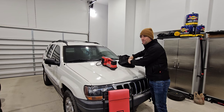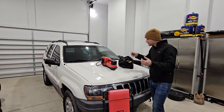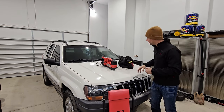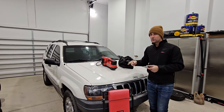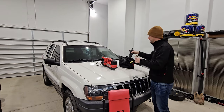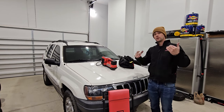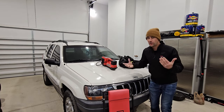What else do I bring? I really don't bring too much. Some rubber gloves so I can check oil. In our 3.7 and 4.7 Chrysler engines, they're known to burn oil, so I like to check before I drive the thing home and bring a quart or two of oil with me. This vehicle had been sitting and was about one quart low, so I was very happy I was able to dump a quart of engine oil in before driving it home instead of purposely driving it a quart low.